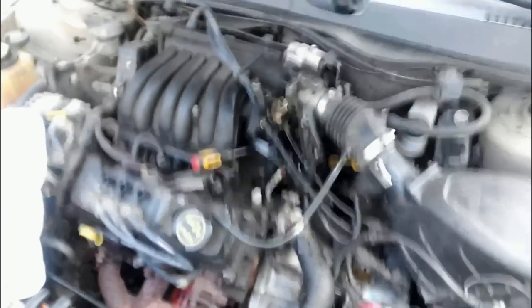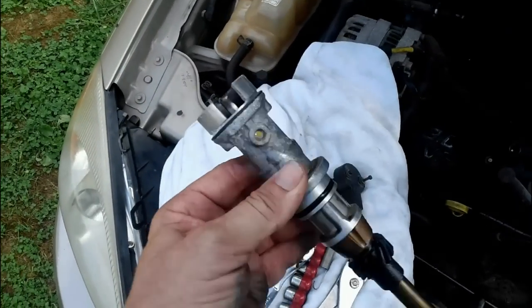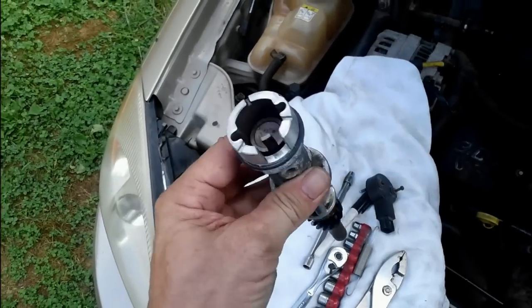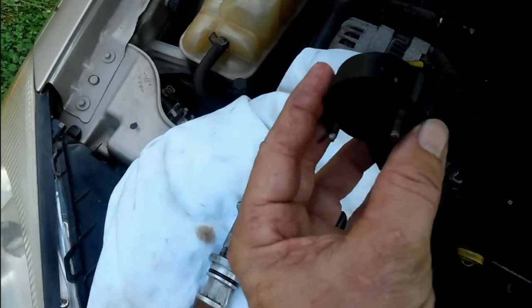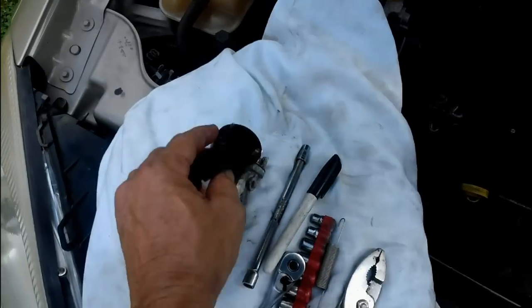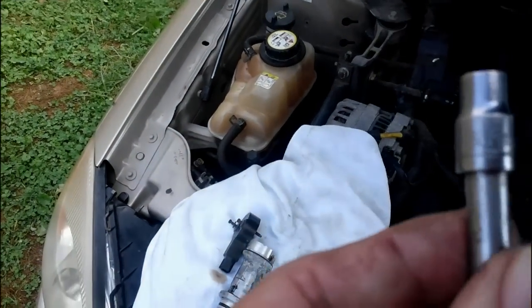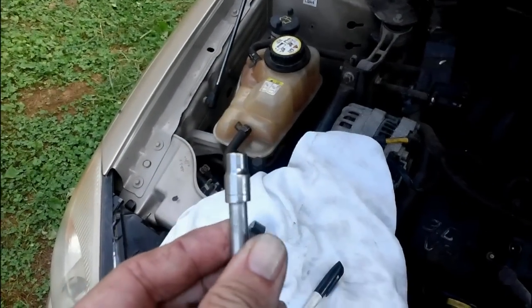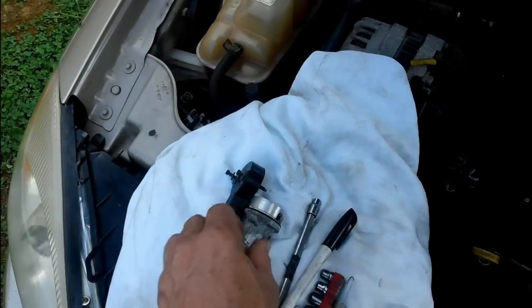Here's what I've done so far. I went ahead and tucked the sensor off the cam synchronizer that's going to go in it. I wanted to show you what it's like — it's got a couple of really long bolts on the top of it, and you have to use a 5.5 millimeter socket to get those bolts off. Maybe a 5 would work, but this is what seemed to work pretty good.